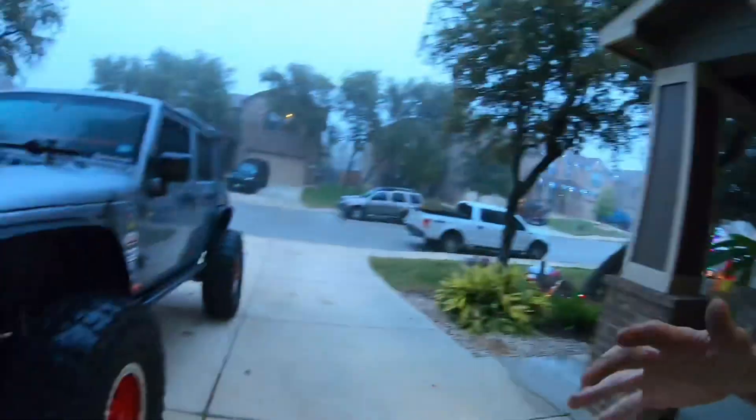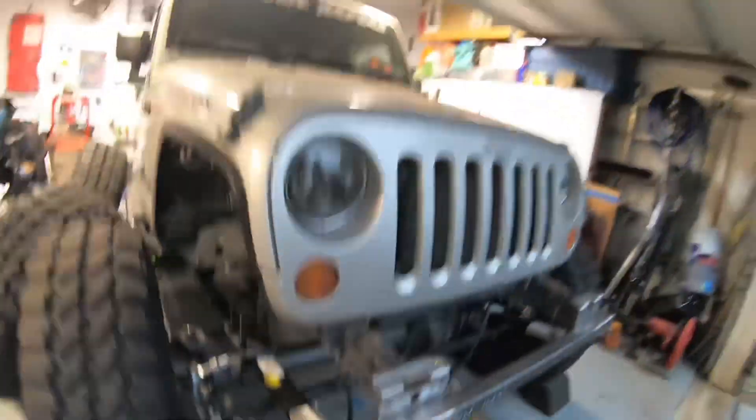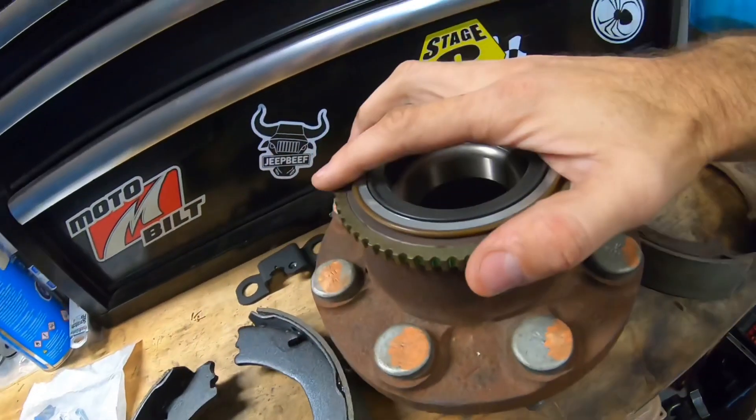When it comes to making your ABS, skid control, and all that kind of stuff work on your JK — whether you have an early one or a later one — the way you're going to want to do that is with tone rings. If you're using a Super Duty Dana 60 like the one we have here under War Paint or under Project Maple Leaf, those come factory with a 60-tooth tone ring if you're going to use the factory hub bearings, which I highly recommend. The factory Jeep runs with a 52-tooth.